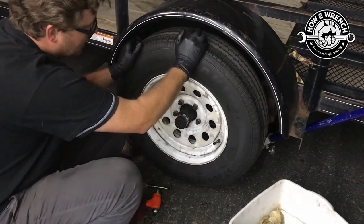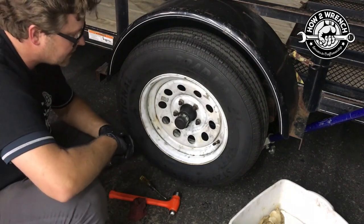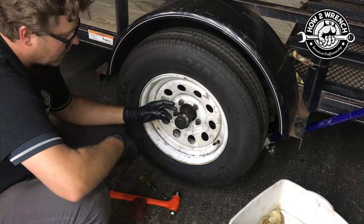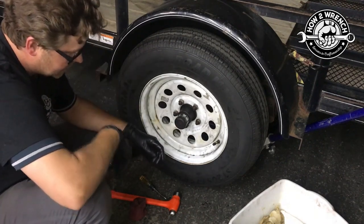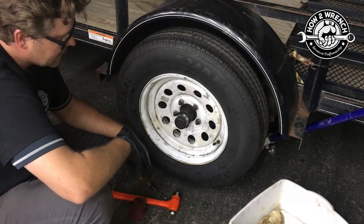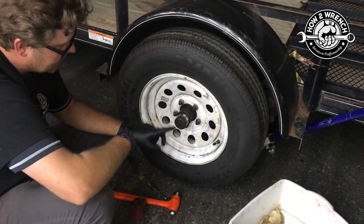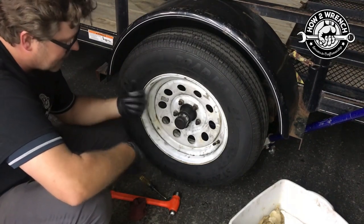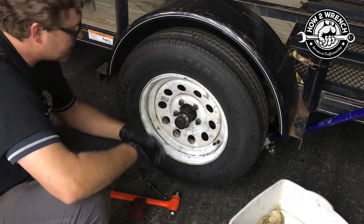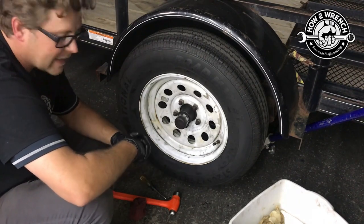Now you know there's next to nothing needed in tools to fix it and make them last for a long time. If you do not do this, that bearing will get so much play, it'll get so hot it'll break apart and then you're really stranded. How often have you seen wheels on the side of the road, broken axles? If you keep it adjusted correctly and keep it lubed up, you'll get lots of life out of it and never see that problem. Alright friends, if you haven't done it yet — like, share, subscribe. Thanks for tuning in. Make it a great day and keep wrenching.